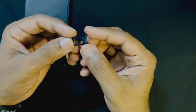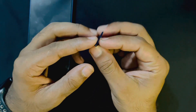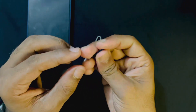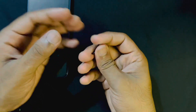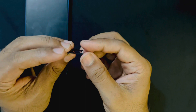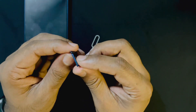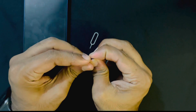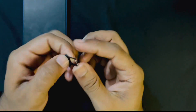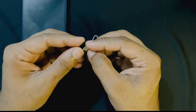What I will do is take the SIM tray and bend it slightly. If you have an iPhone 10, 8, or 7, you can bend it easily, but this aluminum body is really hard so you have to press it a little bit harder. We can see the SIM tray is already a little bit bent, but we need to bend it a bit more. No need to worry — this won't break. Just bend it like this and we can see it's bent. Now insert your SIM card again and let's see what happens.